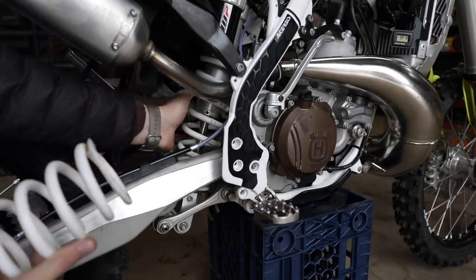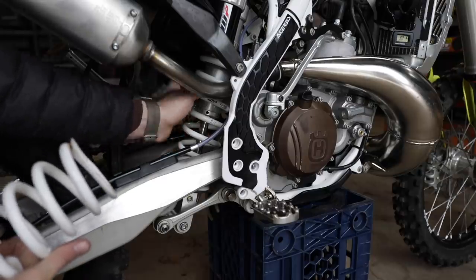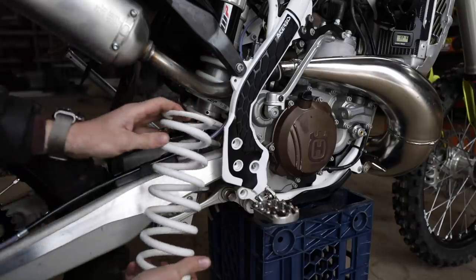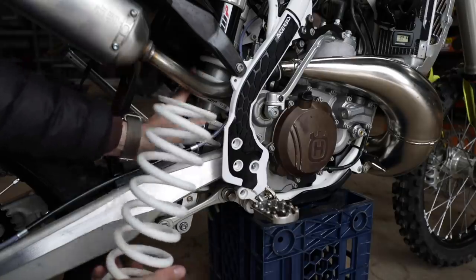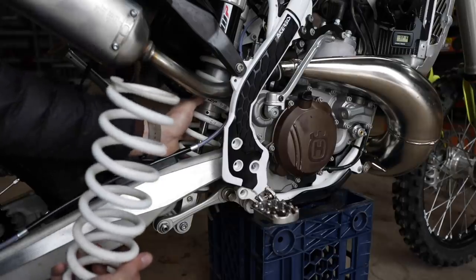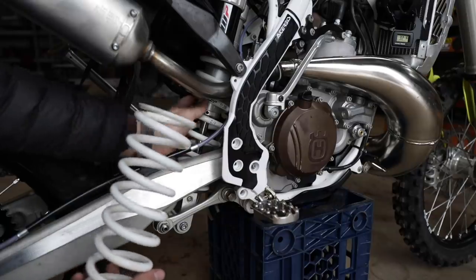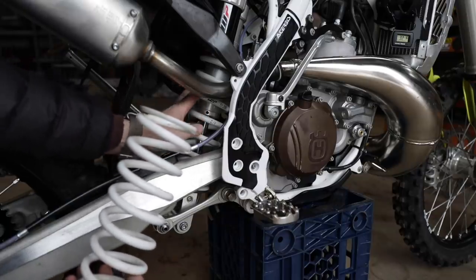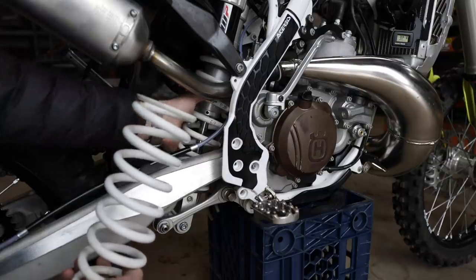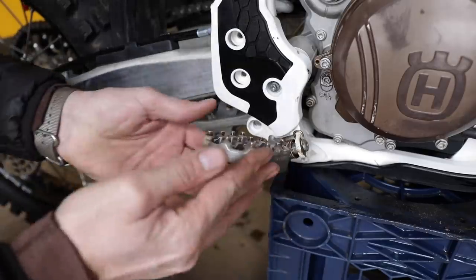One thing that's made a huge difference is replacing the spring on the rear shock. These bikes come pretty undersprung for lighter riders. Working with Bob, I weighed myself with all my riding gear — tools, water bladder, everything you'd carry on a long enduro ride. The factory setup is for around a 160-pound rider; with all my gear I'm close to 250 pounds. So we went up five spring sizes stiffer to level that out and get the bike set up for my weight.